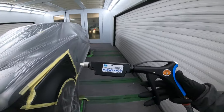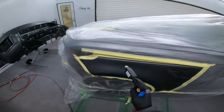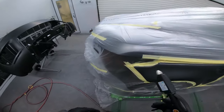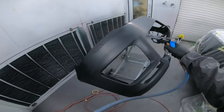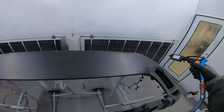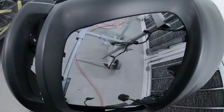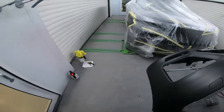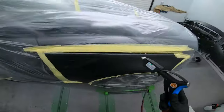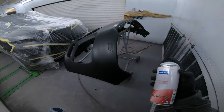That's all the cleaning done now. I'm just going to run over it with the Ion Star anti-static gun. These things are fantastic — it just stops any static build-up on the panels and helps to keep the dust and dirt nips down. We're five minutes in and I'm still cleaning; it's still part of my cleaning process. That's how we're achieving good finishes. Everything is as smooth as possible. If everything's as smooth and as clean as possible, all you're laying on top is paint. As long as you're not doing something crazy causing sand piling and things like that, your paint just goes on flat, your lacquer goes on flat, and you've got a nice finish.